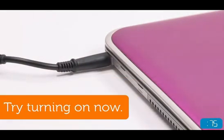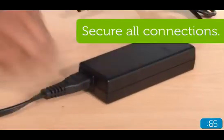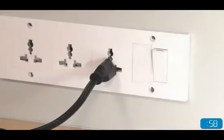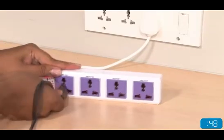If the system does not switch on with the AC adapter connected, try the following steps. Check to ensure that the AC adapter is connected to the wall outlet and plugged in correctly. Your Dell AC adapter has a status LED — this should be lit. If not, try a different wall outlet. If the LED lights up with a different wall outlet, the first one is malfunctioning.